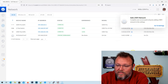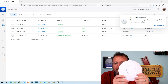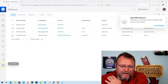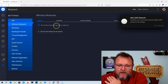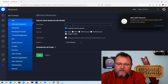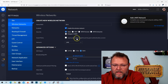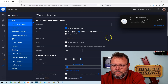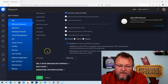It also wants us to add a Wi-Fi network. I don't have a Wi-Fi network set up yet, but you can see it is updating and downloading — I now have a blue ring. So it is going to go ahead and upgrade the firmware. While it does that, we're going to go into settings, into wireless networks, create a wireless network, and we're just going to call this UI-6. It will be directly connected to our LAN network, WPA Personal, and we'll leave pretty much everything else default, just like we did for the Grandstream.